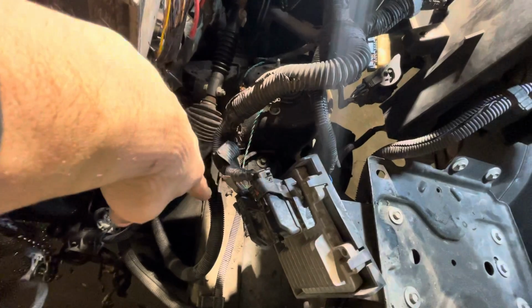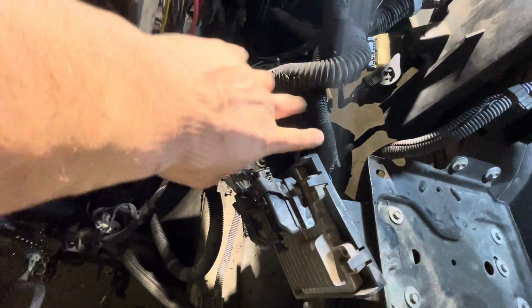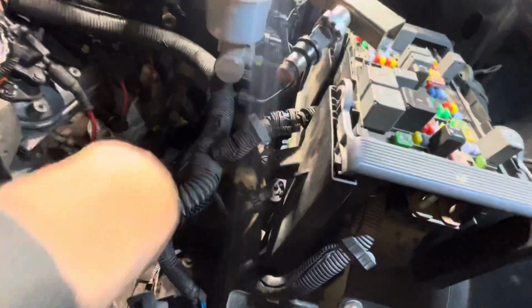Then down here on this powertrain control module, it's kind of small for the newer ones, but it has a black and gray clip. I believe it was black on top, gray on bottom. And then on the rear, it has another clip. So there's 3 clips. They go there, and then one here. With these 4 clips, the harness will come off for the engine.